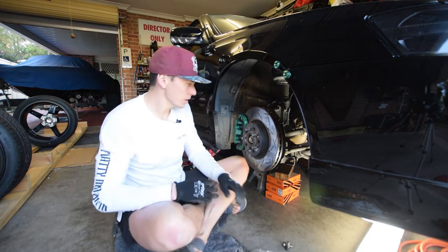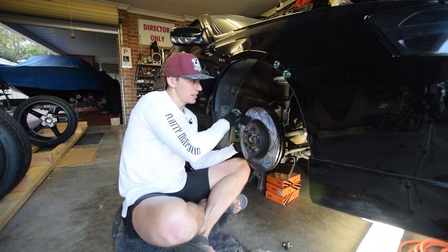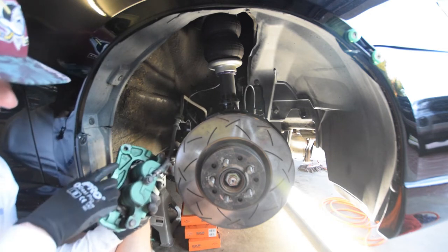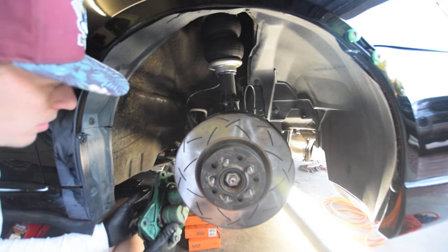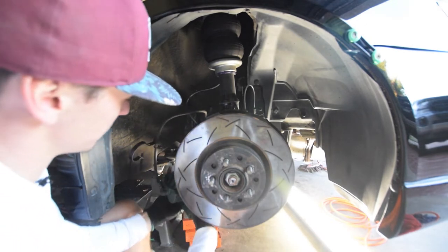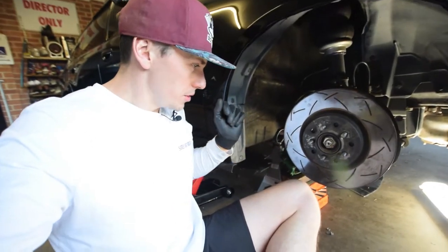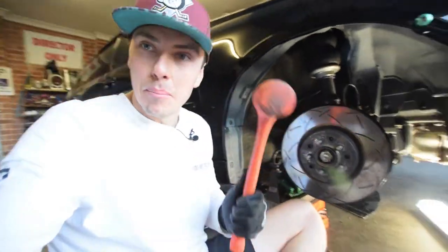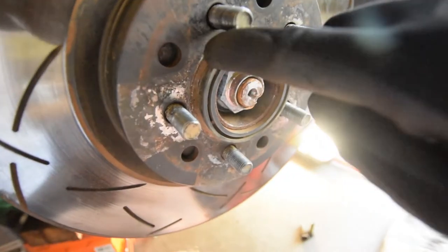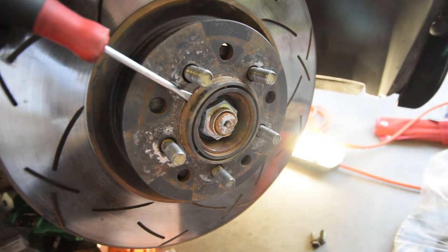All right, so that's it. This brake is completely loose — the bolts obviously here and here. For now, I'm just going to sit them on something I've prepared earlier, which is three boxes of golf balls and a piece of wood. We're going to need to get this rotor off. Don't be like me and just start bashing at it for a while. Get a small flathead screwdriver and wedge it in here — there's one on the other side — and pop this off like that.